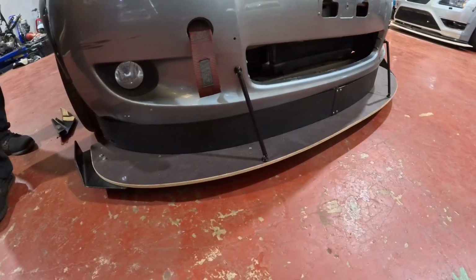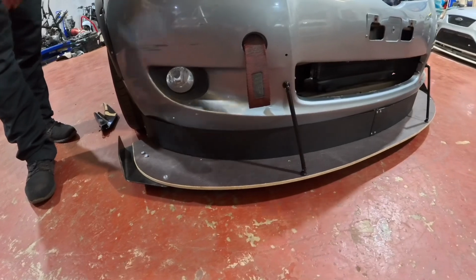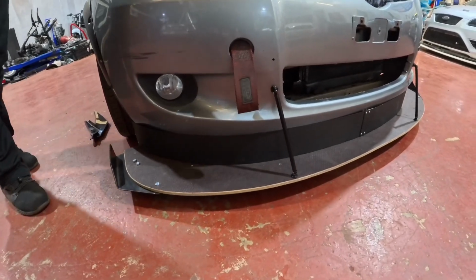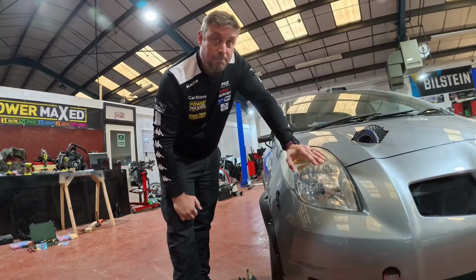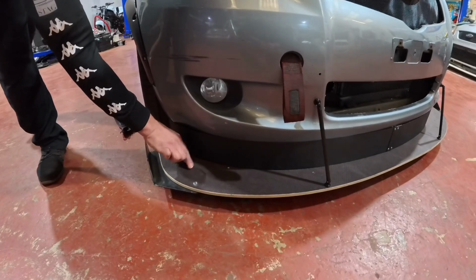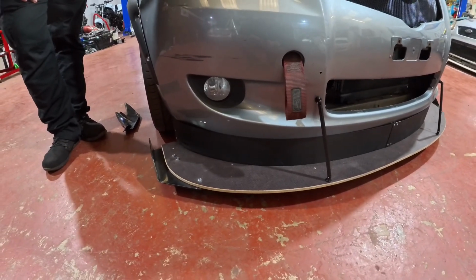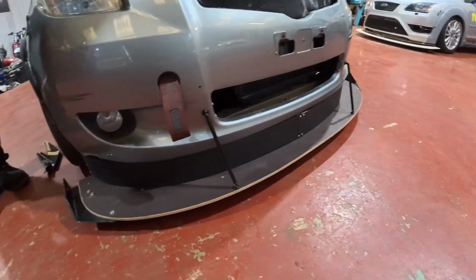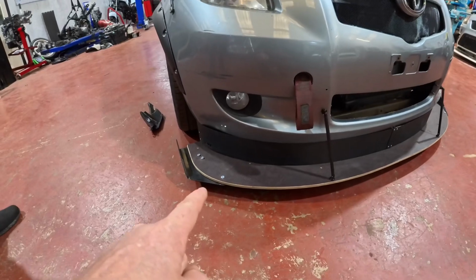That was a bit of work, all relevant to the students' qualification as well. Tools and equipment, using a hacksaw and learning how to cut straight. Now, some can cut straighter than others. We've got some 1/2-inch box section behind here, which is what spaced this out. We had some tired arms at the end of the day, but they all learned how to measure, how to cut, and a bit of fabrication work. It actually looks quite solid there, Chris, when you just put your hand on it.